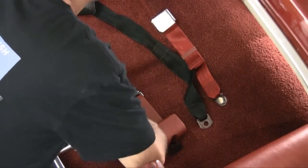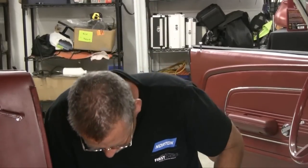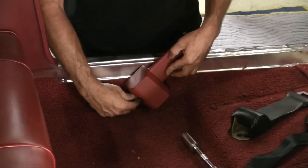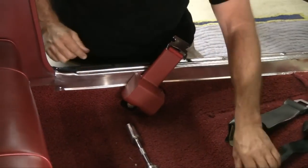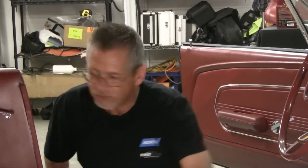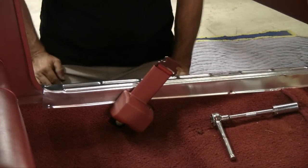We got one part of our seat belt in, putting the other one in now. Very straightforward — just a simple bolt, take it out, move them. This thing has a shouldered bolt; you'll want to keep that shouldered bolt so the belt can actually slide down to the side when it's not being used. If you use a standard bolt and tighten it all the way up, it's going to stay in whatever position you leave it. Doesn't that look so much nicer? There is not much prettier than a red car with a red interior, and when all of the red pieces match each other instead of black accents, it's just that much better.